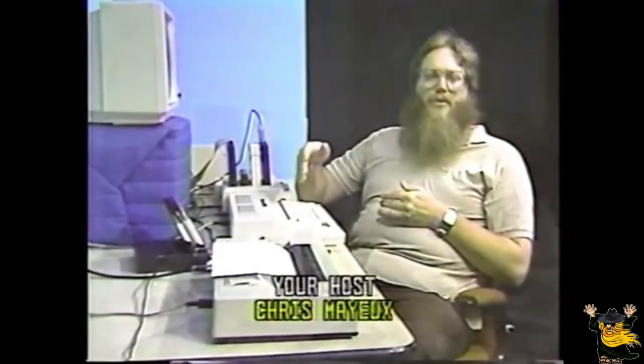Now, before we go, let's take a look at what we've learned and how we can use it. First, we learned how the RS-232 cartridge has four addresses in memory, which we can use to turn on the cartridge and send data in and out of the modem. And we can actually change the way the cartridge works to operate at different speeds, or how many different bits we'd like it to use, or whatever. And we saw the PRINT #-2 command, and how we can use it to send a string or a string variable to the printer at any given time. Then we saw the LLIST command and how it can be used to print all or part of a program's lines to the printer.